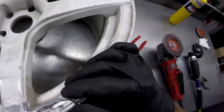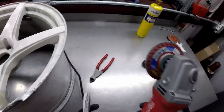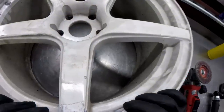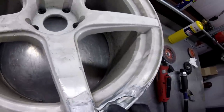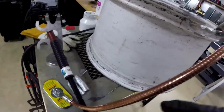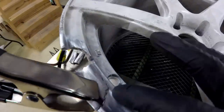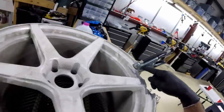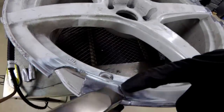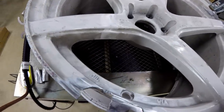That's pretty much as good as I'm gonna get it. I've got my magnet here - it's just a magnet with a little snake thing that goes to a clamp - so you can see I've got it clamped here, it's pretty well in position. Got my ground on, got everything ready to go. I'm going to weld this sucker up and I'm probably just going to put a tack right here for now, and get that to where it's going to stay. Then I'll try and get the other one in there in case I need to move it a little bit to make the other one fit good.